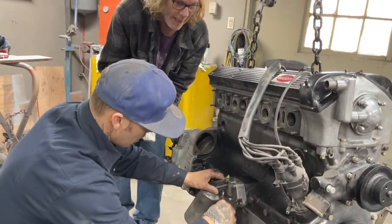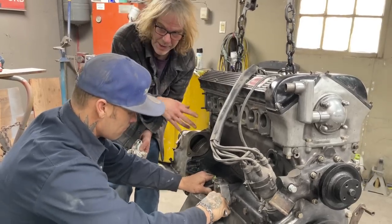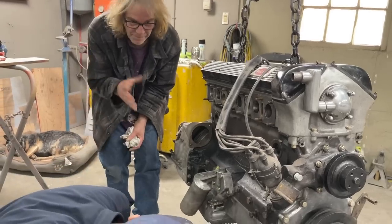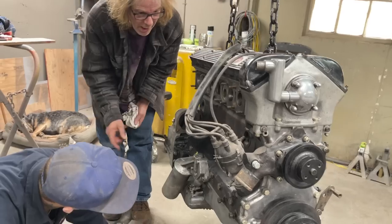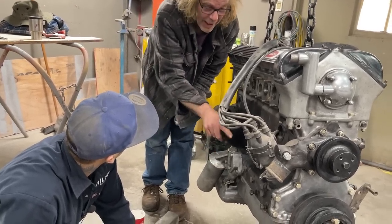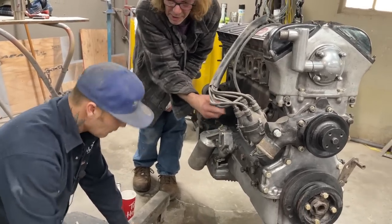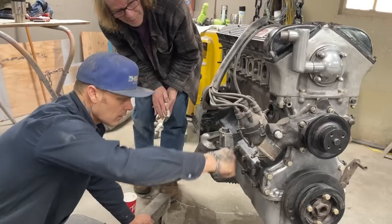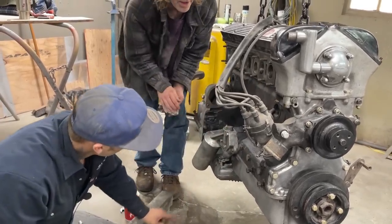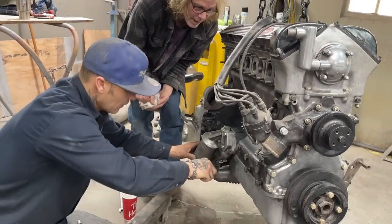See, this is where that buddy that has your other motor might have some insight about some of this stuff. So before you're done, you might want to contact them for a couple heads up on a couple issues. Probably. But I wouldn't touch this, and I don't like the idea that those bolts weren't tight. I wouldn't take that off because I'm not sure of the ramifications of how it lines up. You know what I mean? I'd unhook it here and take the oil pan off. I'd leave that alone. Instead of unhooking the hose, that's going to be too hard to get off, we'll just unhook it right here. Yeah, that looks simple enough.